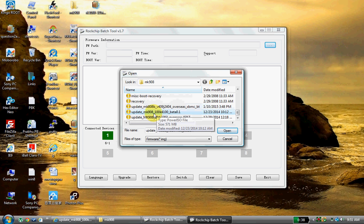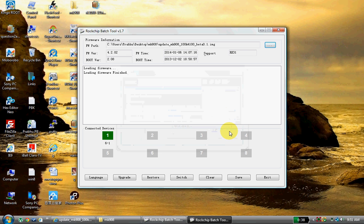This is the 4.4 KitKat version for the Android Mini TV from manufacturer B-Link. You have to be very careful — if your manufacturer is only B-Link, then you have to select this firmware. Click on Open and you will get the firmware version loaded.